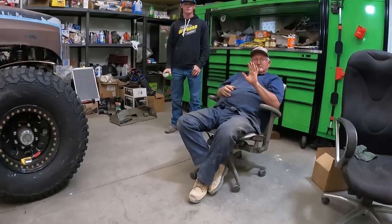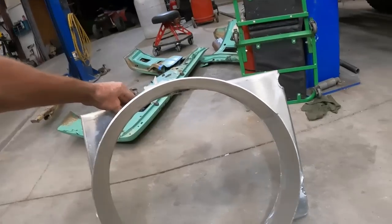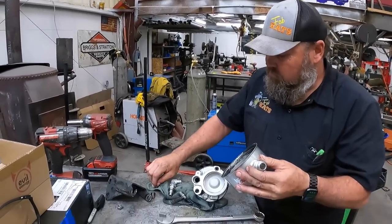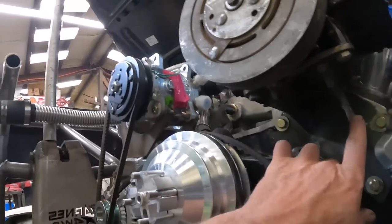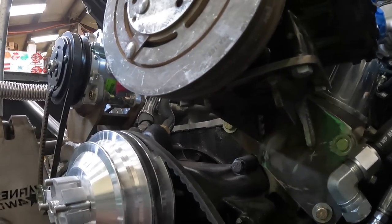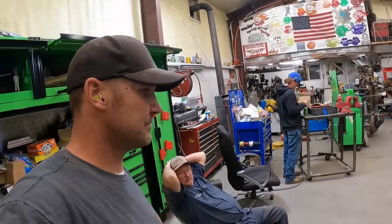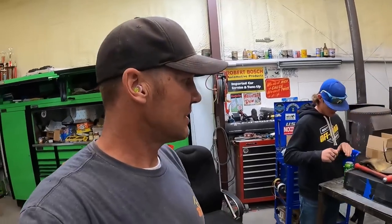Even Dara showed up to the shop. Ben had the power steering pump all fixed, then he tightened the belt and we didn't have the clearance right on the top fitting - bent the housing, made it leak again. So he had to tear it all back apart, straighten the housing and fix it. I think it was four times he tore the pump apart that day, but it's fixed and it works now. Everything's in its place with no leaks.